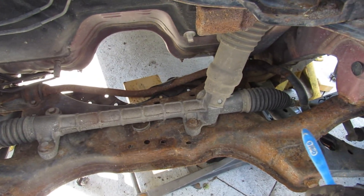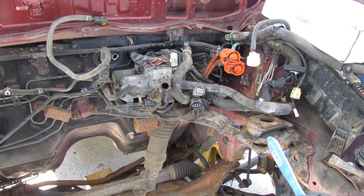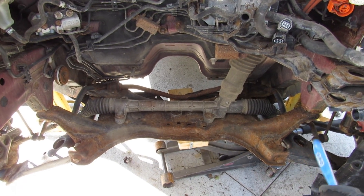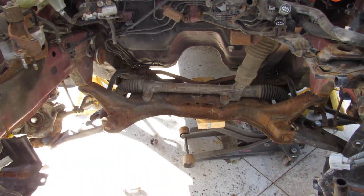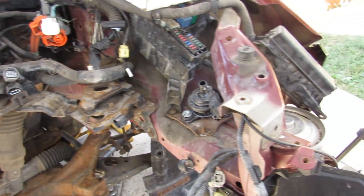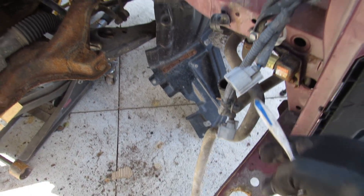Looking around inside here we've got the steering rack with a column-mounted electric power steering motor — I want to do a video on that. There's also this crossbar which kind of prevented me from taking the transmission and engine out upward because I didn't want to deal with that yet. If you do have a hoist it makes this a lot easier — you can drop the subframe down first, then drop the engine and trans down, lift the whole car in the air, and drag out the engine-transmission combination with the engine crane. So after one pile of front end parts and an empty engine bay, the engine and transmission are finally removed. I hope this gives you some tips on removing the engine and transmission from a Toyota Prius. Overall it was pretty straightforward other than the mess of coolant hoses and all the extra water pumps and reservoirs in this vehicle.